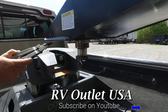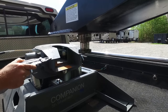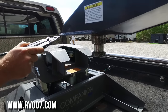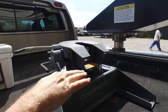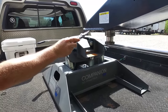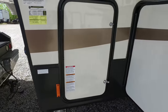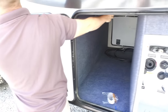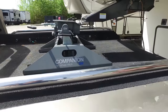The action of the pin will only line up with the jaw if the plate rides on top of the hitch head. Right now it's entirely too high. The back of the fifth wheel head has a downward ramp, and the kingpin plate has an upward ramp — these two plates are made to meet each other as I back up. If they meet, the truck will slide under and I'll have contact between the plate and the top plate of the hitch head. I'm going to go ahead and lower this unit down.